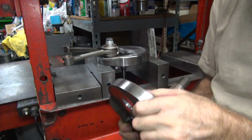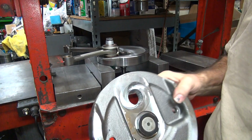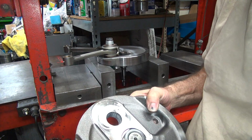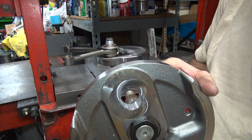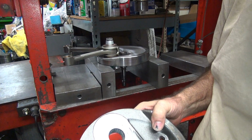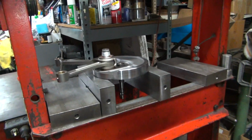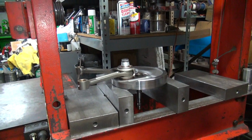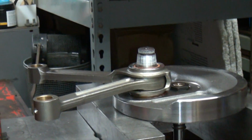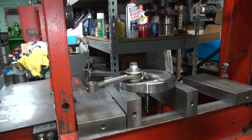Alright. So we're going to have to pull that crank pin out because you see how much I was flexing the whole thing over trying to get it out, so I'll take it apart and retorque it. So anyway, that's Loctite for you. Even though there's no nut, it's on there. The sleeve retainer does its job. You can see all the Loctite on the taper and the nut right there. See all the goop on there? That's how you know it's well Loctited.